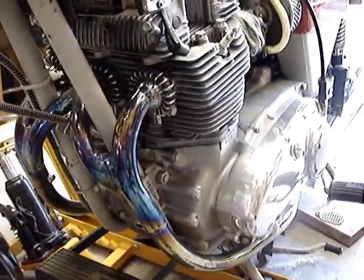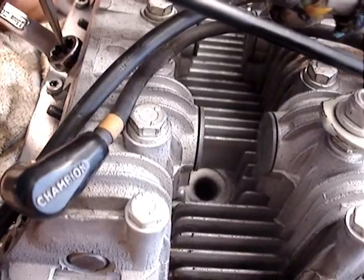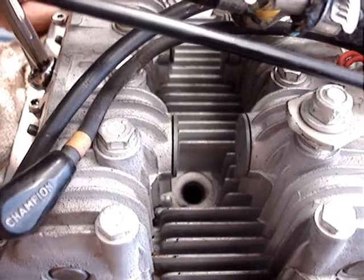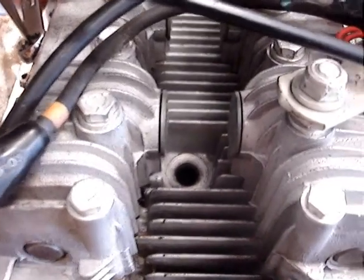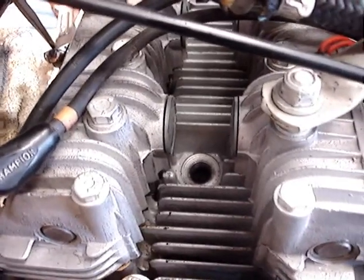You can put this on YouTube — they don't have one. The valve adjustment's very simple: you bring it up to top dead center on the compression stroke. I'm at 6 on the intake, 8 on the exhaust. And if you don't know what that means, you probably shouldn't own, drive, or service a motorcycle.